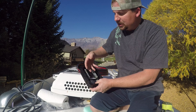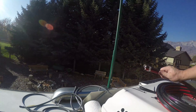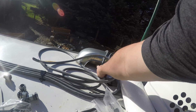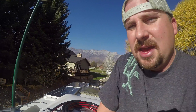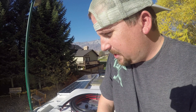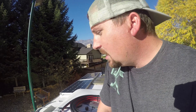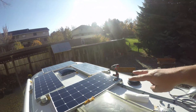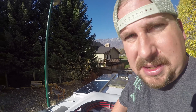Today we're going to be running the grays into here and the red and black out. The red and black is going to go through — I have to drill some holes — through the fridge vent and down into the interior. Kind of freaky drilling holes in that, but we're modifying the trailer. It's also freaky knowing that these are generating power right now, so I'm not going to be wiring these while the sun is out.